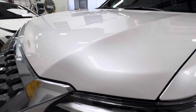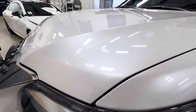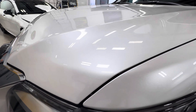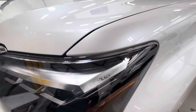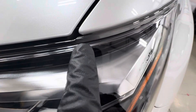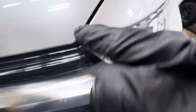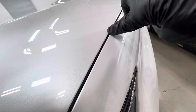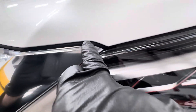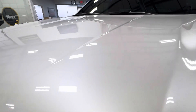Starting here on the hood — the hood was done in 10-mil film for that extra protection over 8-mil. Eight is fine, but two more mil of protection is nice. We wrap all those edges and corners, and the PPF wraps all the way into the motor bay for this fender. All these corners are fully wrapped so we don't leave lines on top.